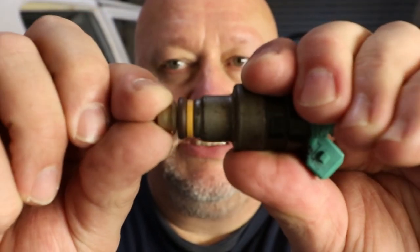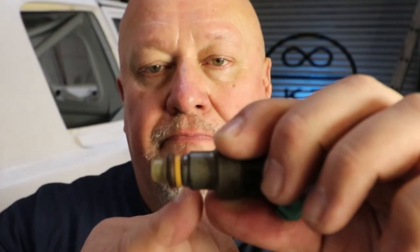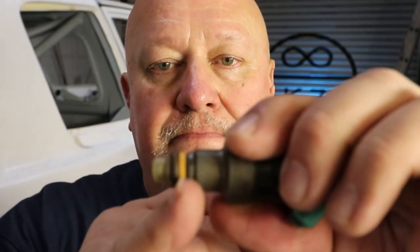What I think has happened is that little nozzle bit on the end moves up and down and it shouldn't — it just rattles. There should be a seal in there, and the seal's gone, and the fuel's come out from the end above that orange extrusion ring and out all over the manifold. But we'll see when we get it to pieces.